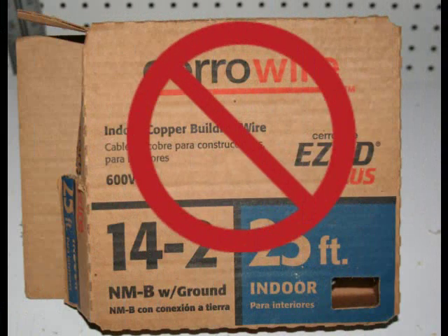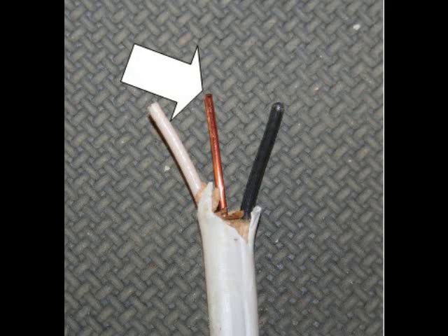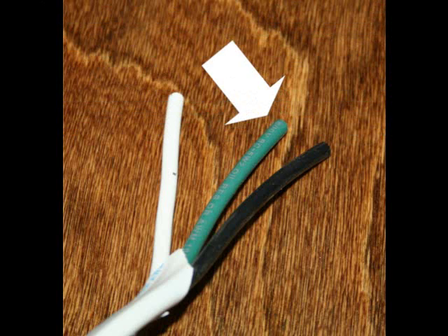Now let's talk about the right wire to use. Don't use standard household wiring. As Jack Hefner from Gratitude Yacht Center pointed out, if you use that type of wire, you're not going to do well on a boat inspection. The household wire is a solid cable and the ground is not encased, compared to marine wire, which is stranded and also tinned. The ground on marine wire also has a protective casing on it. The right wire makes a big difference — tinned wire lasts a lot longer than standard copper wiring.